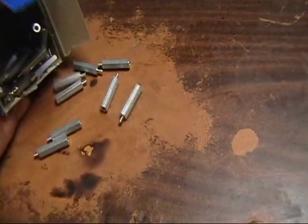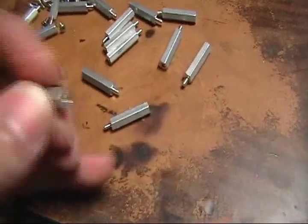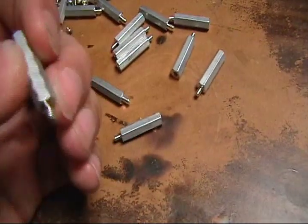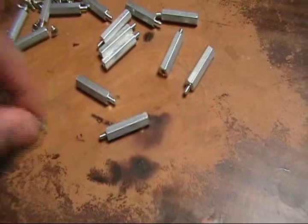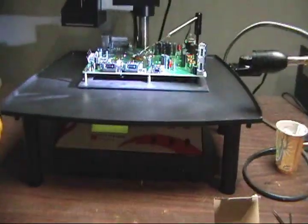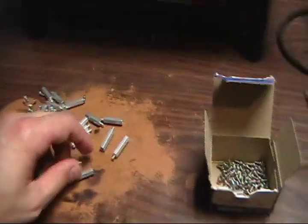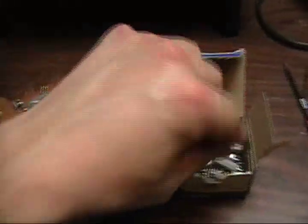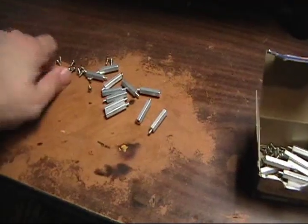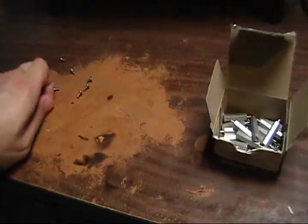For my laptop motherboards I use 4-40 standoffs, one inch long, with a male end and female end. I just put the standoff against the bottom of the motherboard and then put a 4-40 screw on top, in all the holes. It keeps the board completely flat — I know it's flat because all the male ends are touching the griddle. On my last griddle they wouldn't because the middle was bowed, and it's got to stay completely flat. You won't find a better deal than Grainger; Lowe's only carries them in little packets at outrageous prices.